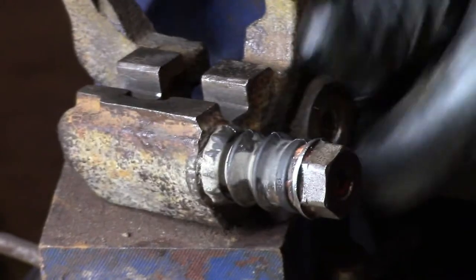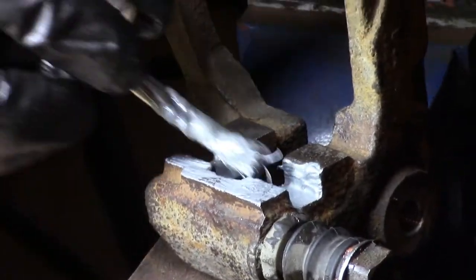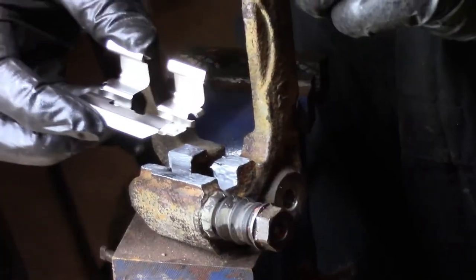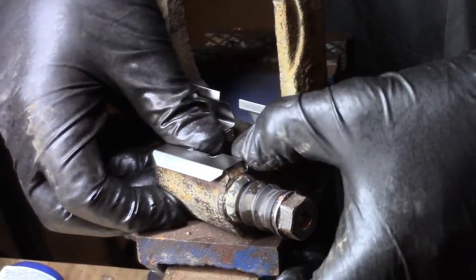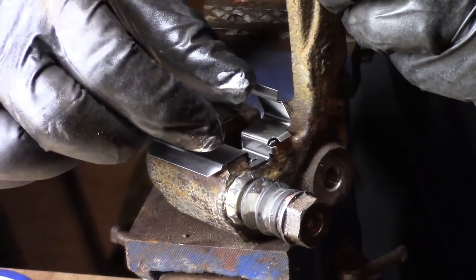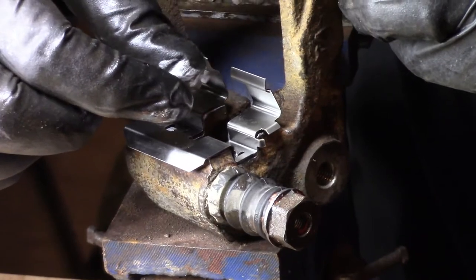So this is underneath the stainless steel hardware that comes with the brake pads. We don't put lubrication on the stainless steel sliding hardware because it doesn't rust. You slide this in here like that, and snap it down just like that. So that's where rust will form on the underside of this, and if rust grows in there, it compresses this sliding hardware, and then your brake pads won't slide as easily because it's being squeezed.